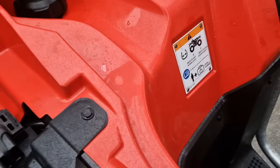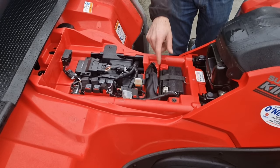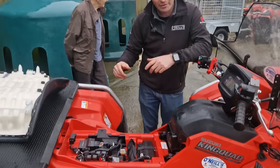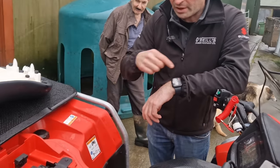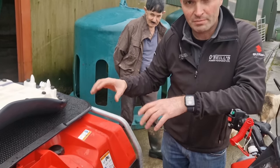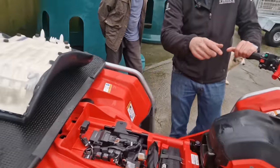Because if the tires are overinflated, they can't grip. And that tire gauge measures from 8 psi and down, where your normal tire gauge measures from 10 and up, and fellas run 30 psi and they're pumped too hard. So tire pressure is the key thing in a quad bike. 5 psi all around, you're good for grip then. If you're struggling in very soft ground, you can drop a bit lower if you want to. Perfect. So tire pressure is a big thing and your tires will work really well then.